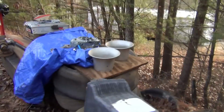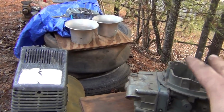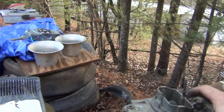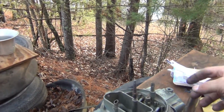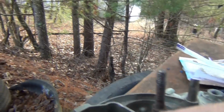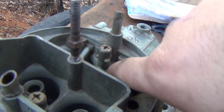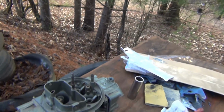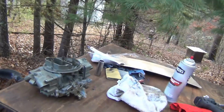Yeah, this right here was the aftermarket carburetor, the kind you buy over the counter for that engine combination. I got this from Jimmy Klontz. He had it on and ran it everywhere, and then it developed a stumble where he could not get it fixed. And when I rebuilt it, I found what was wrong. One of the air bleeds right here had a crack in it and it had an open hole, so it was pulling too much air. So I epoxied that closed with JB Weld and it ran great back 4 years ago when I fixed it. Spin it over.